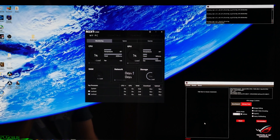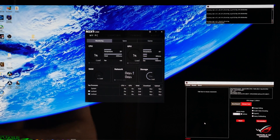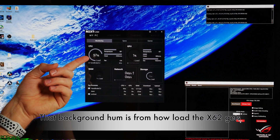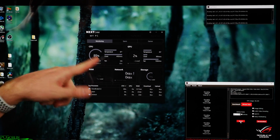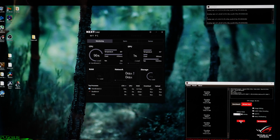Now on my 9800X system, we're going to run the same test we did on the wet bench with the Ryzen chip — comparing my AIO, which isn't quite as good as a custom loop but still pretty good, against the Shadow Rock 3. This time we're using a much hotter chip, the 9800X, set to factory settings, but it's still a really hot chip that uses tons of power. We started the test and already off the bat we're jumping to 67–69 degrees. After way longer than 30 minutes, we're idling at about 68–69 degrees with the AIO.